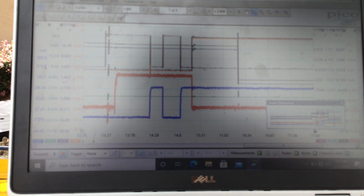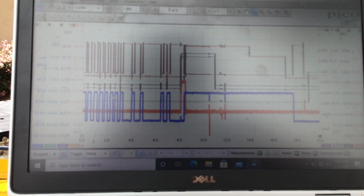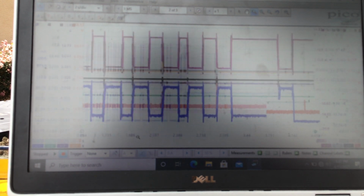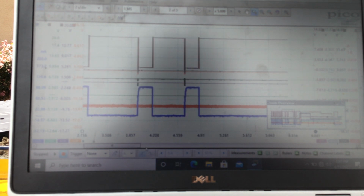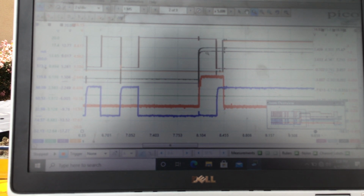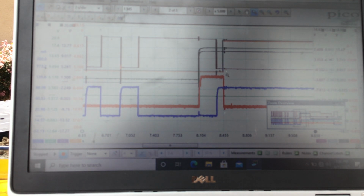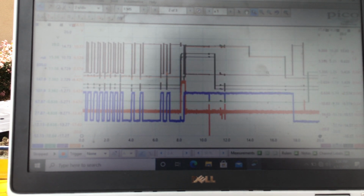And then I got to my next spot right here, and we can see the relationship between the park pin switch and the key interlock solenoid as we're going down the line. And then I'm off the brake, and then what happens here, I get back on the brake because black and purple go high. The solenoid allows me to come out of park if I'd want to. The park pin switch is closed. When the park pin switch is closed, there's current flowing through the key interlock solenoid.